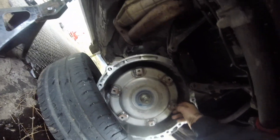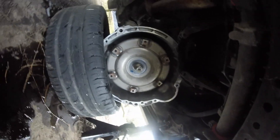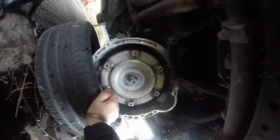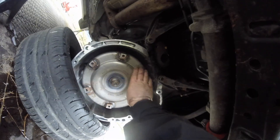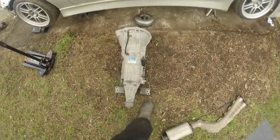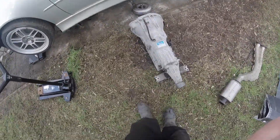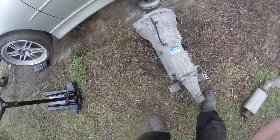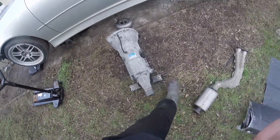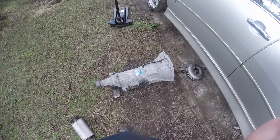You can see why you need to remove those torque converter bolts — the torque converter is physically bolted to the flex plate, which is bolted to the engine, so it won't separate until you take them off. In case you're wondering why it won't come off — I did a GS300 before and that was why. Right, get this out, get it cleaned, and there we have it — one automatic transmission. I believe it's an A340 but I could be wrong — it's a four-speed.